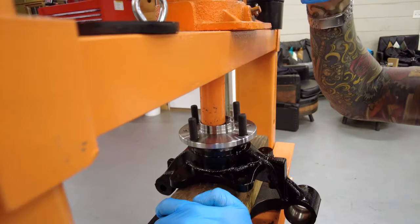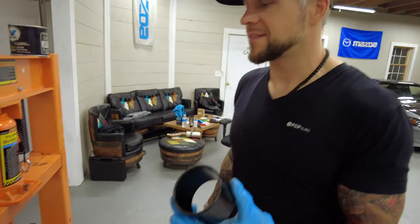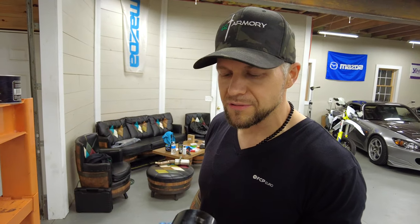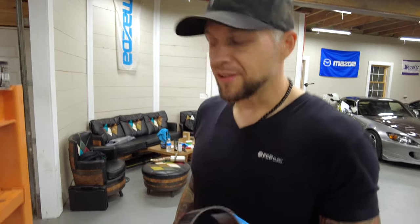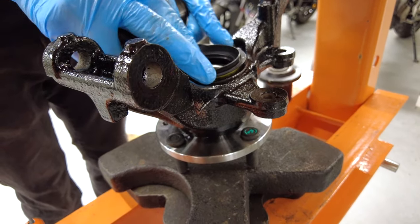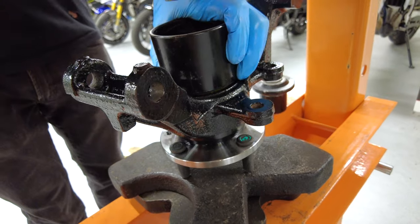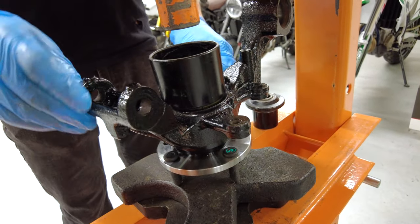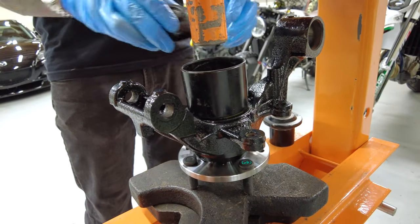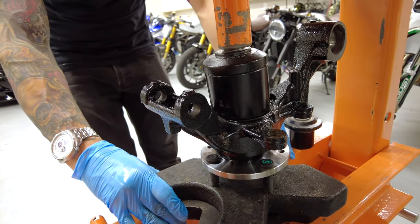These cups came with my Harbor Freight ball joint / universal ball joint kit — I have three different sizes, and the large size is perfect for the dust shield seal on the rear. So here's our new seal — I'm just plopping this guy right in here. Did you grease the seal? I don't think it needs it. We didn't grease it. Do we have to grease it? I mean, I greased the bearing first — oh, you did? Oh god, it's gonna break.